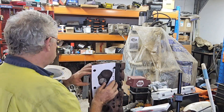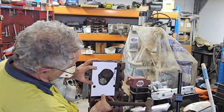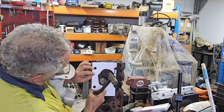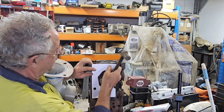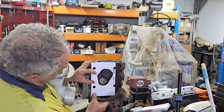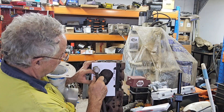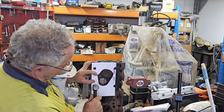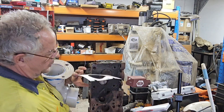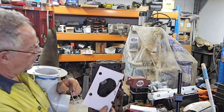So basically — trusty little ball-peen hammer, piece of cardstock — line it up on the edge so you've got a reference point to come back to. You go to the edge, take the hammer, and using the round face you just gently mark it. I generally start off with my bolt holes, so I mark my bolt holes out. This bit of stock was a bit small — it's just out of one of these books — so I got a shape.